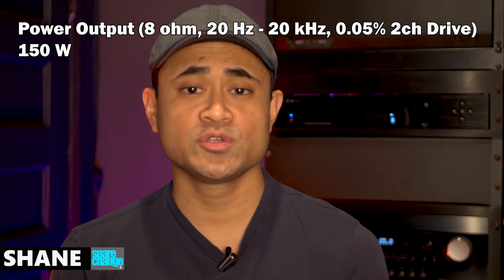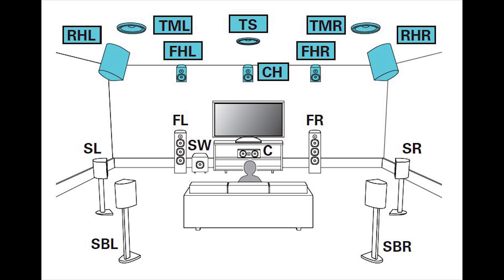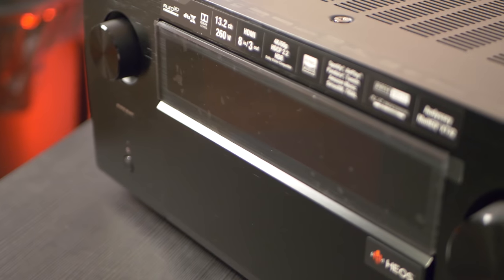Don't get me wrong though — the X8500 is no slouch. The receiver is rated at 150 watts with two channels driven at once, so it should be enough to drive most speakers. The screen effects and panning throughout my room sounded precise and very distinct. You also have the option to use the Audyssey editor app once you run the Audyssey setup, giving you more granular control to fine-tune your system. I think if you have a medium to large-sized room this receiver is really gonna stand out, especially if you're gonna run multiple rows of seats. Having six height speakers is really gonna blanket you with sound, but if you have a smaller space I doubt you'll hear much of a difference trying to cram six speakers on your ceiling. I did set up a pair of wide speakers to listen to some Atmos soundtracks and heard very little going on in them. There was more happening in wides using the Neural:X up-mixer, but you do lose your back speakers. There's just a ton of listening options with this receiver.